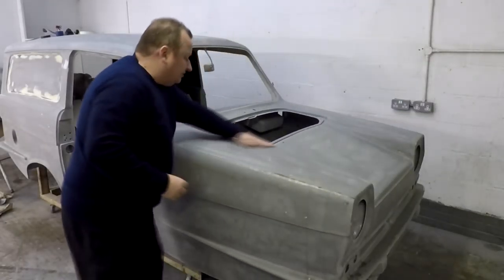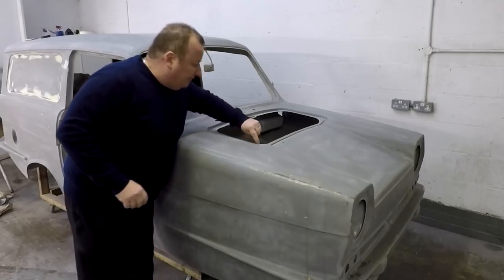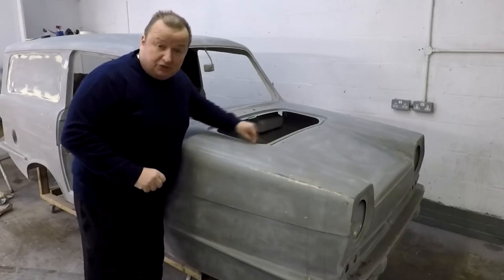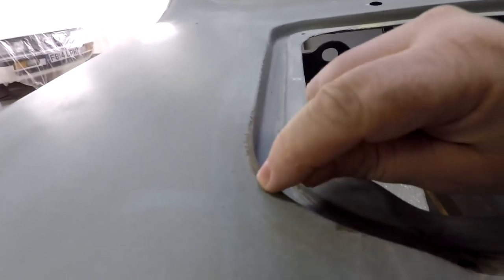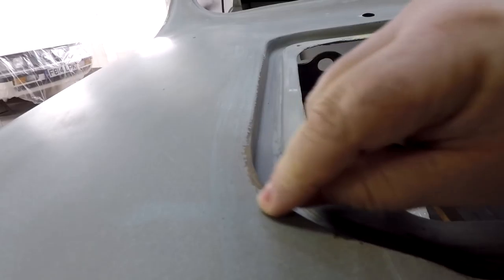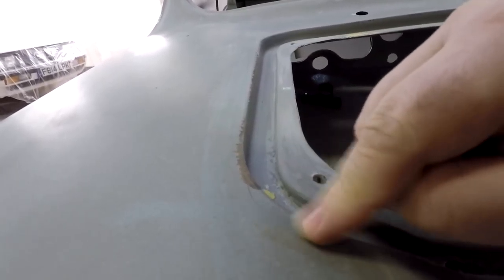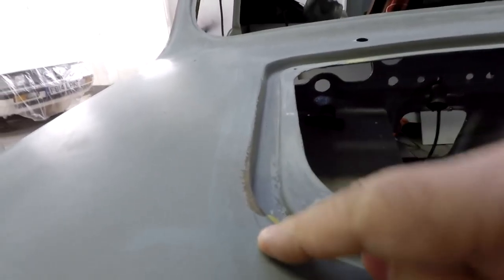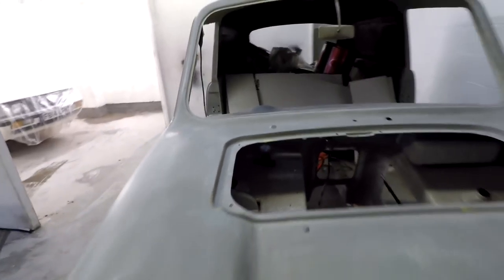And while I've pulled this out, I've just noticed that there's a little bit of a fine crack in the gel coat around here, which I'm just going to have to dig out and fill. As you can see, just in the bonnet there, it's only a very thin thing, but you don't really notice everything. That's why it's always wise to walk around the car a few times and let it settle down after you've done work so you can see stuff. That's just got to be ground out there. We'll put some fibreglass P40 resin in there and that will strengthen that right up. That's on the corner of the bonnet area.